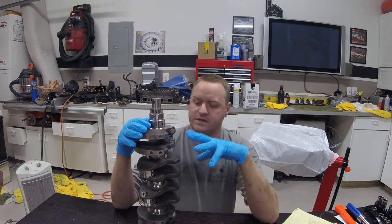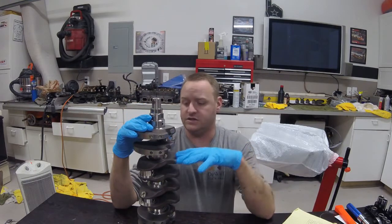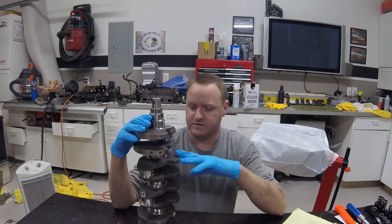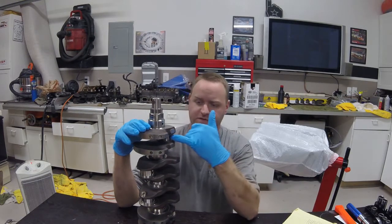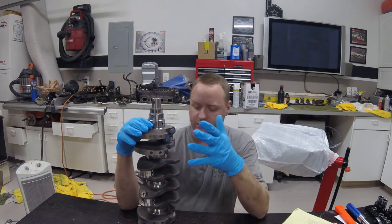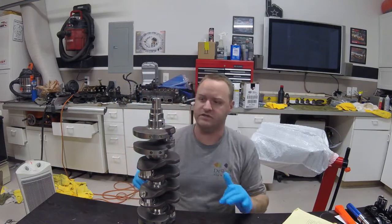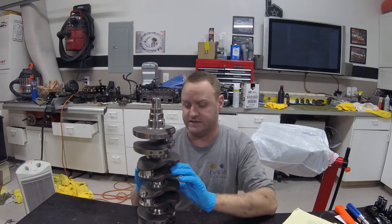The next step was basically going outside and, much like I did with the engine block, doing a paint thinner solvent bath with my solvent gun and then rinsing with hot water. After that, I went ahead and did a Super Clean bath on it, focusing a lot on the oil galleries and oil ports in the crankshaft itself, getting those all cleaned out, and then once again rinsing with hot water. Now the crankshaft is back, completely cleaned out — all the ports and every surface has been completely cleaned, dried off, and is ready for installation.